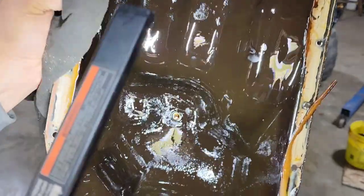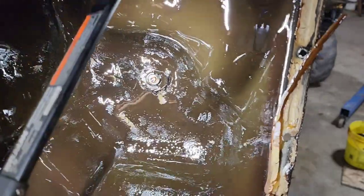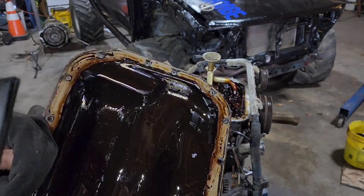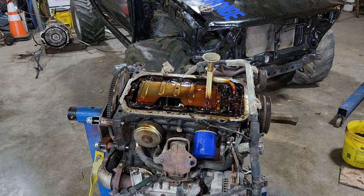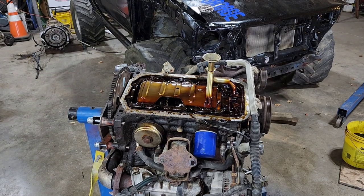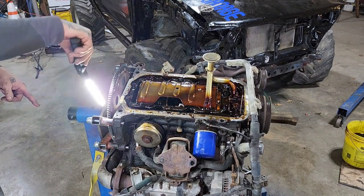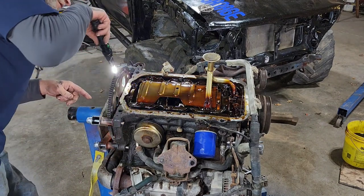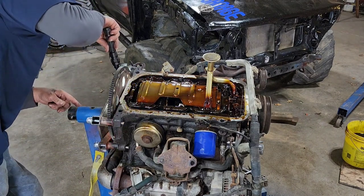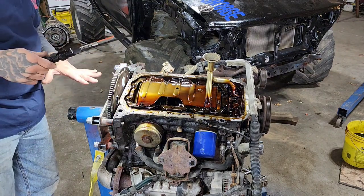You can see inside the pan there's a little bit of crud right down there in the very bottom, some gasket material, but the inside of this engine is awesome and amazingly clean and has no sludge buildup. I'll clean this pan, clean that surface, get this back in, get that engine upright. I did give this rear main seal a thorough inspection and it is not leaking at all — not a drop anywhere. I'm going to believe that's OG Toyota and just accept it — it's good, leave it there.